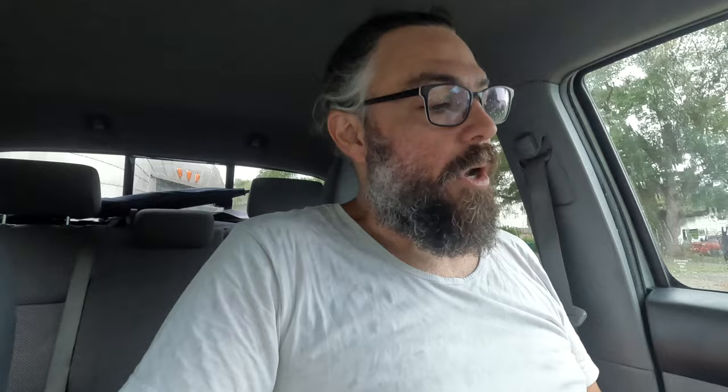Nothing at all — so I've done something wrong. It's now raining outside and I did a whole heap of troubleshooting. I thought I might've got the wrong earth, I thought I might've done a whole heap of things. It turns out that for the lights to turn on for the brake controller, all you have to do is have the trailer plugged in. That was the one thing I hadn't done.